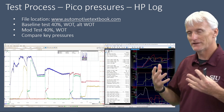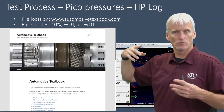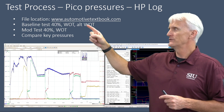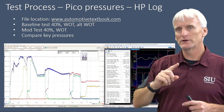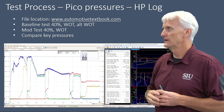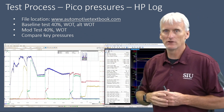These experiments followed the same process: I measured clutch pressure at the individual clutches and recorded it using the HP Scanner feature. On the baseline test, I ran the vehicle at 40% and wide open throttle, plus an alternate wide open throttle. The only difference between those two wide open throttle runs is that the alternate didn't have throttle reduction during the upshift as torque management. On the modified test, we ran at 40% and wide open throttle as well, comparing accordingly.